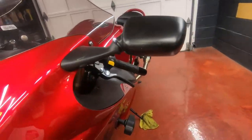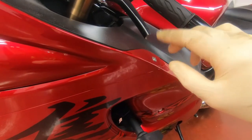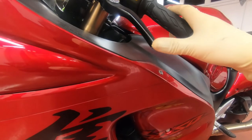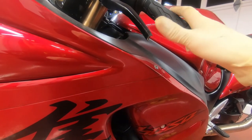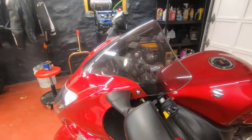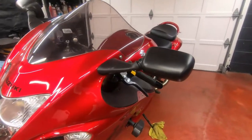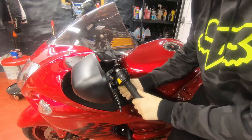Now I'm gonna move over to this side to do the clutch. As you can see, I did a whoopsie doopsie here and it broke. This is kind of dangerous — it's all sharp, it's cutting through my gloves, that's no good. It's mostly because I had a chain jump. This side is the same procedure — I'm gonna start by loosening the nut.